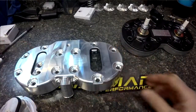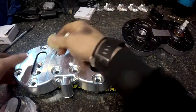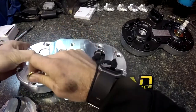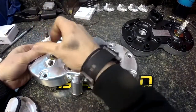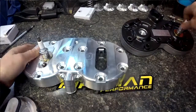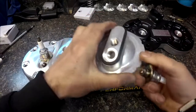The easiest way to do that is like I got this here — you take a half inch washer, get the dome in place, spin that spark plug in the hole. I already had it done on the other head but we're showing you on this one.